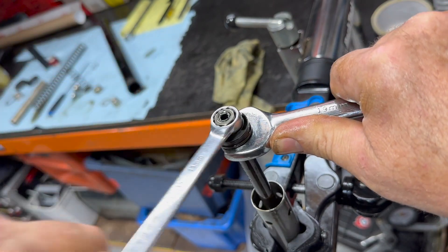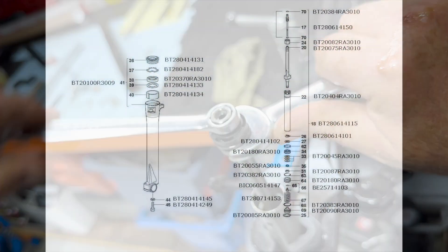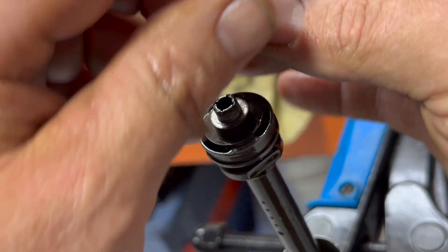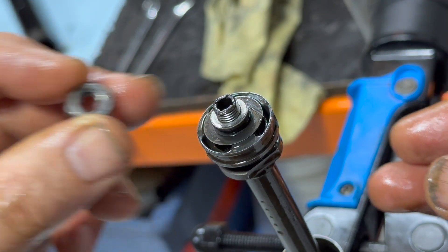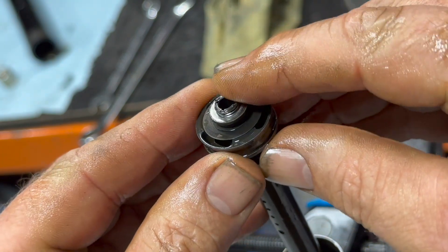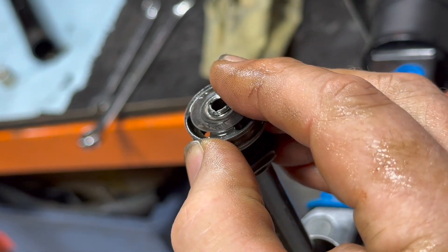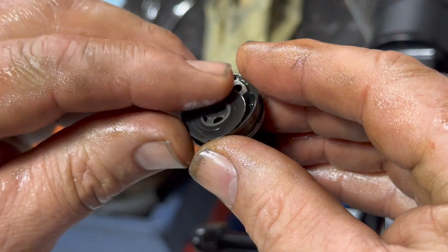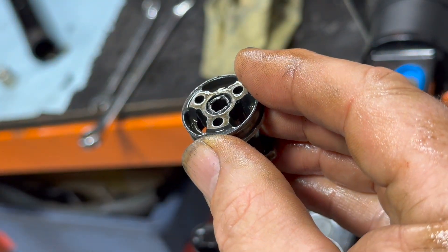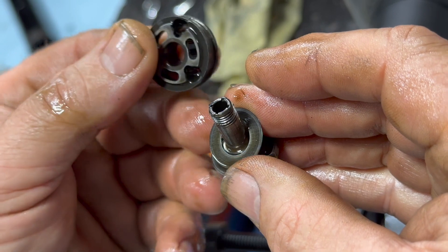What we're going to look at is a broken shim washer. Get your spanners on there, unlock the locking ring, and wind this off. Be careful when you lay everything out after taking it apart — it all goes back in exactly the same order. Lay it on your bench as it comes off with the top parts facing up. You'll have a nut — put it on the bench the way it came off. Then there's a little step bush — the widest part is to the top, or to the bottom when it's in the forks. Then there are two shim washers that control the oil flow to the piston: a small shim washer and a thicker shim washer. Then we've got the piston.